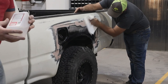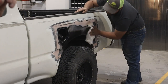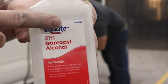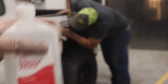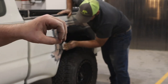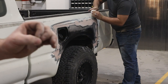What we're doing now is prepping the panel for primer. 91% isopropyl alcohol is what we're using — that gets oils, dust, and dirt off the panel. All three of those are going to be your worst enemy when it comes to paint. You're going to be fighting it if you don't clean them off.